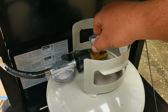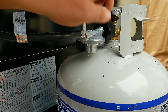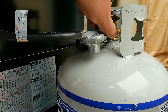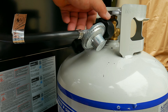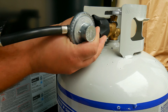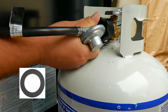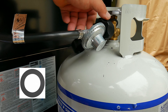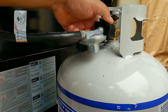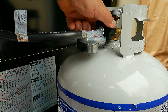The first thing we want to do is turn off the propane gas tank. We want to re-verify that we have a tight connection on the line. The best way to do that is to disconnect the line and reconnect it again, making sure it's tight. If you reconnect it and you still get the smell, it could be an O-ring in the rubber connector or the actual propane tank. If that's the case, you want to replace the propane tank, the O-ring, or the entire hose.